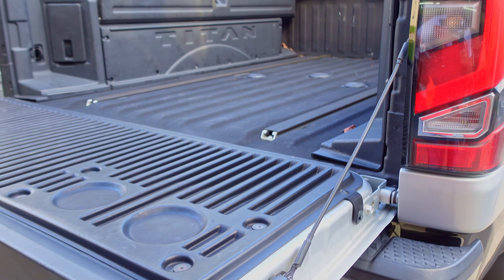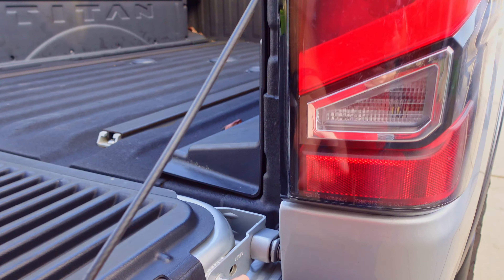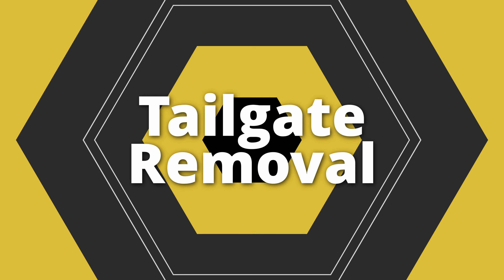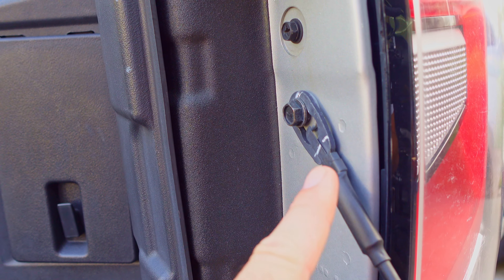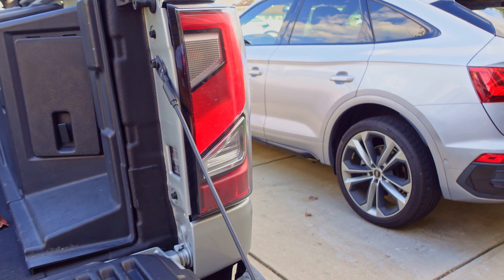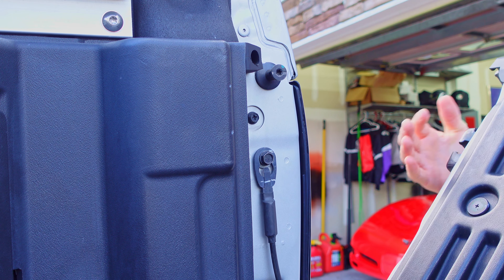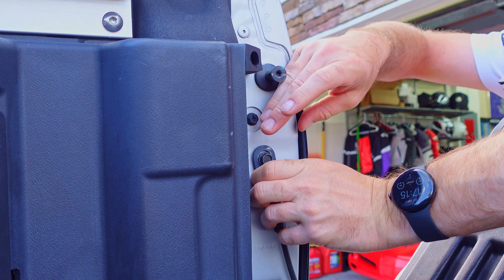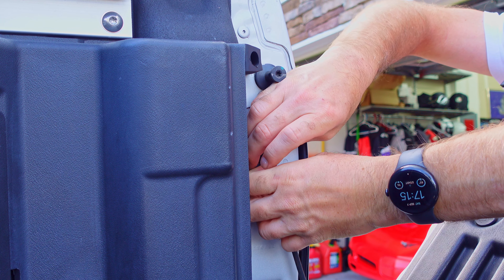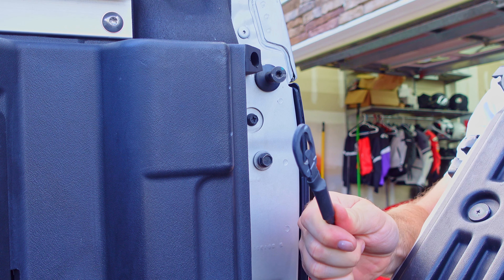This product basically replaces that with aluminum, so hopefully your service life is a whole lot longer. Obviously this is a pickup truck, the tailgate is meant to come off, so we're going to talk about that first. We're going to remove the tailgate and replace this bushing. First we're going to look at this cord right here — it keeps the tailgate stable when you have weight on it so it doesn't flex out. We're going to hold the tailgate up at about a 45 degree angle, flex this out over this bolt, and slide it up and forward to remove the tailgate support.